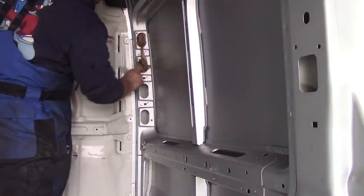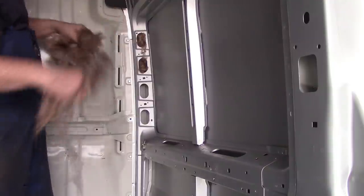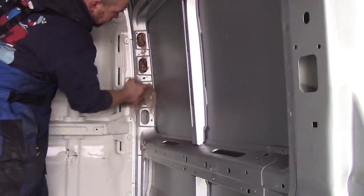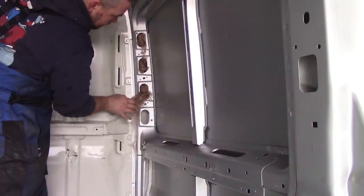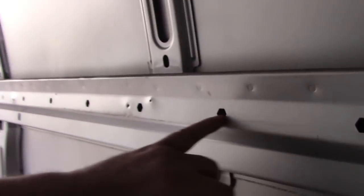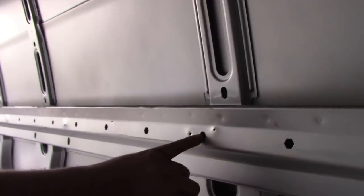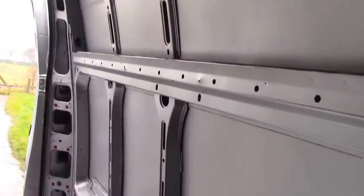We were really hoping to avoid using any spray foam at all, but unfortunately Mr. Citroen has designed this in such a way that some of these reinforcings, like this one, let me show you, have insulation on top, but these are the only access holes, so there's no way I can stuff glass fibre in there. We're going to have to tape up the holes on the bottom and tape up alternate hexagonal holes, and then stick expanding foam in there, which is horrible evil stuff.